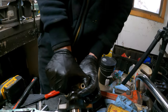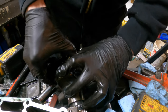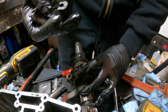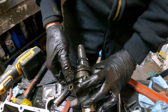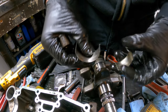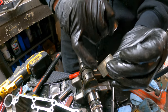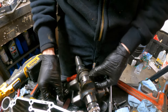I got a little interested and wanted to see what the bearings look like. The first one I removed was still okay. The second one — oh wow. That is a completely blown-out bearing. Look at that thing. It should be that thick all the way around. She spun a bearing big time. The reason you can't reuse the shaft — see how smooth it is here? And here it's all rough — it dug in pretty good. When it had no oil, it wasn't doing much lubricating.